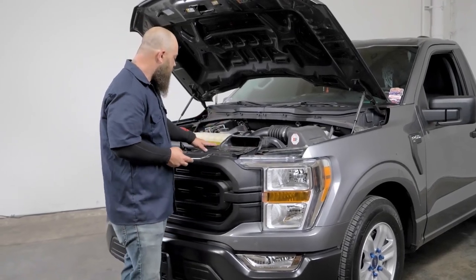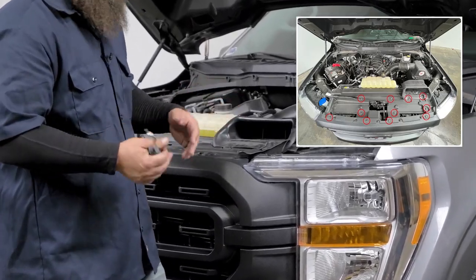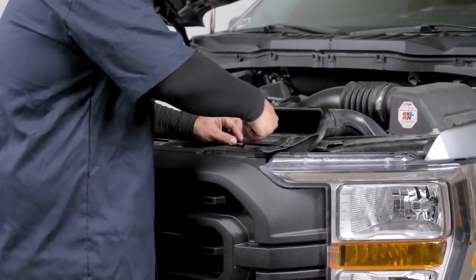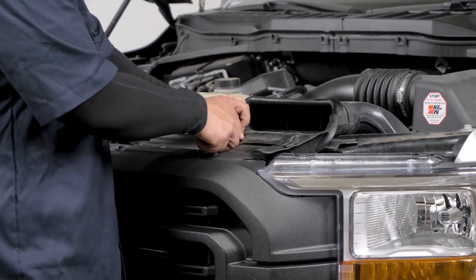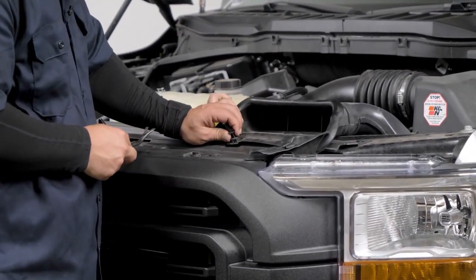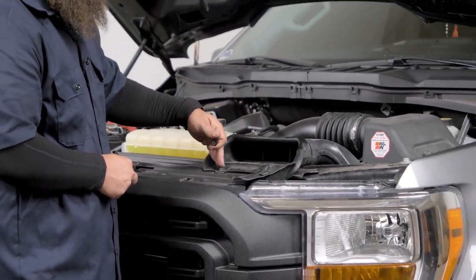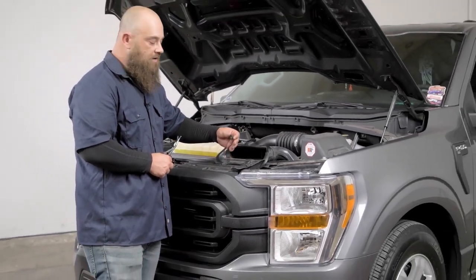So in order to remove this, there's 14 tabs in here, and you can use your fork tool or a small flat blade screwdriver works as well. There's a little notch right in here. Slide that in and then slide it underneath the bottom piece, and you can go ahead and just pull this right out just like this. And you want to do that for all 14